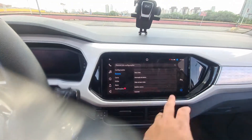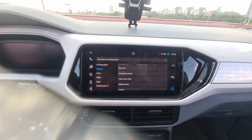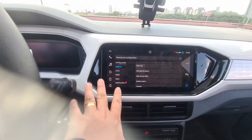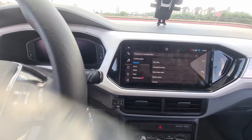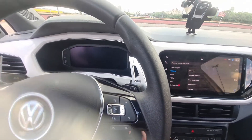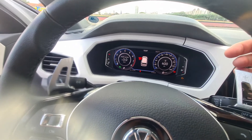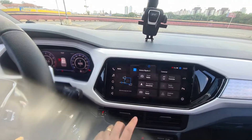The trim here is a bit loose because I'm still trying to update the multimedia. That's why the frame isn't fitted — I just push it here and it snaps in perfectly. A tip for anyone installing the Discovery or the VW Play: only these systems can control the layout of the instrument panel. So changing the panel display — autonomy, consumption, etc. — only the VW Play or Discovery can do that.